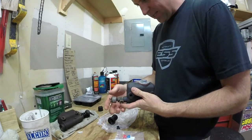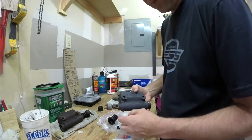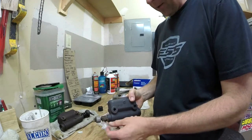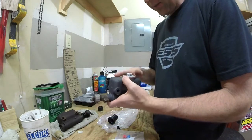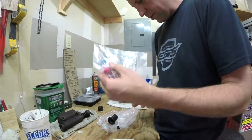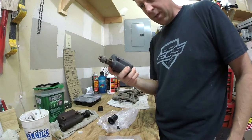I'm going to open up the garage door. Looks like a little bit of a yard sale here, because there's a swap meet on Saturday up at Bandimere Speedway in Denver, about an hour from here — if you're local, check it out. I'll put a link up top for how I bench bled before on my old Model A — I did a pretty good in-depth on bench bleeding. But essentially just recycling the fluid: if it comes out of here, putting it back in here. I'll dump some fluid in, then slowly work the piston until I get all the air bubbles out. Then this guy's ready to go — put a little cap in there, which I think came with the kit, and go shove it in the car. Enjoy some good music as you watch me bench bleed this thing.